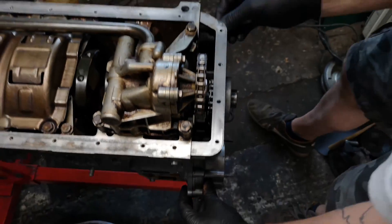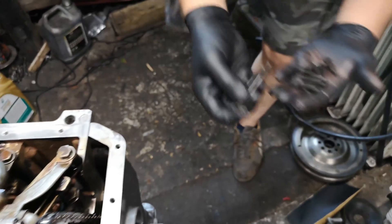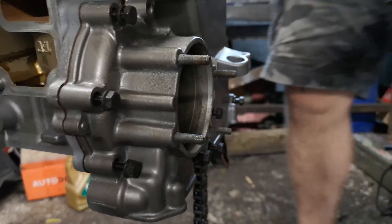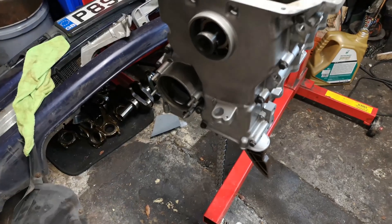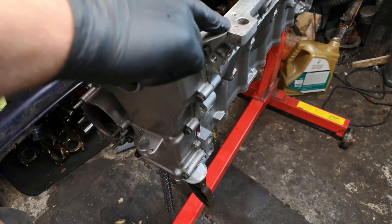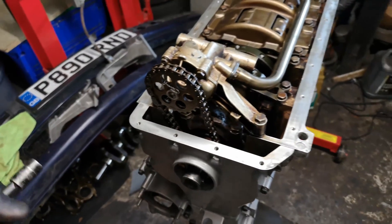I've got a whole stack of bolts, then four slightly shorter ones with a nipple on the end, and then four much longer ones - those clearly go where the case is thicker. I reckon the four other ones are for the sump, as there are four bolt holes there. I'll just give them a nip up - they don't need to be crazy tight. This cover is mainly stopping oil from being sloshed off the chain and coming out the timing case. Around the area where the timing case meets the sump, you need a little bit of silicon sealant to stop leaks.